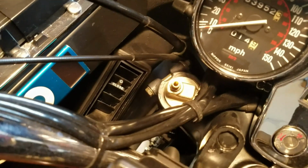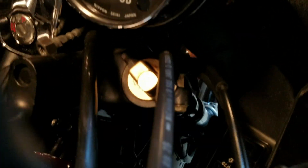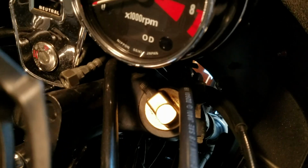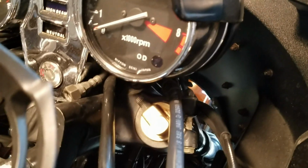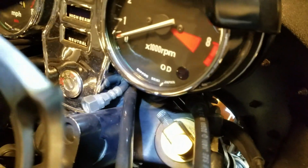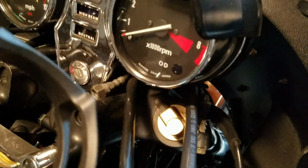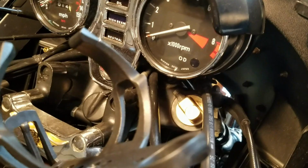Mine, like I said, I'm going to add in, we'll get to that, but I'm going to try to add it in through the air fittings on the 83. So on this side, that's where I pulled the air cap off and pulled the valve out when I drained it, relieved the pressure, and then I just disconnected that bolt, little hose that connects up to it. It's that little end right there connects up. The hose is just right up there on top. Anyway, that was a 14 millimeter. Took that off. So then I'm going to put the fluid in through here.